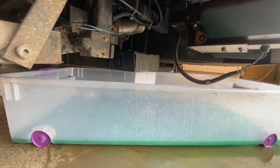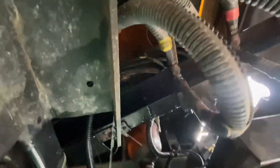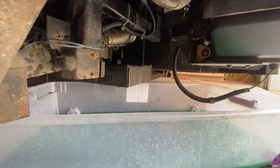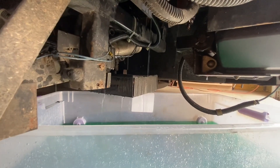Draining the coolant still out of the front of this. There's a bleeder valve on the Bluebird here under the front end, up in the middle of the hose up there. If you have the bleeder valve out it's pushing it through, so we've drained as much as we could. No more was coming out of these heater cores, but once we added new coolant it's still green coming out, so it's pushing it through.